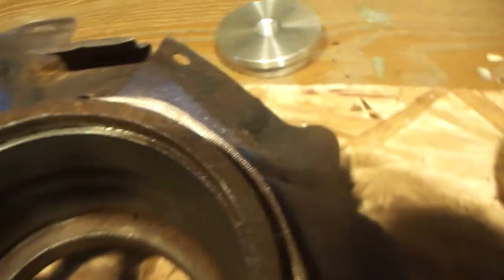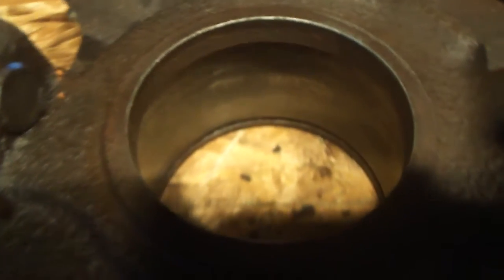So stating the obvious — on this hub, if I just turn that over, this is the base of the hub and the bearing actually sits against here in this groove right in here. Your first impression, some people might think you just need to start hammering on here — no, this is actually what it sits in. This is a recess, and you can see that's the recess, that's the base of the bearing. The bearing is only going to come out in this direction.